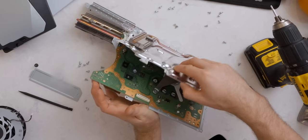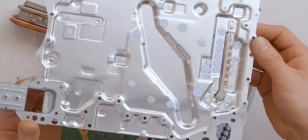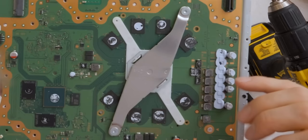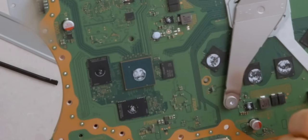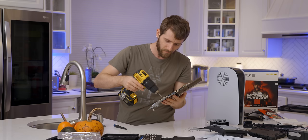That is not a lot of thermal compound — they've just got little dots on each of the DRAM packages and the NAND packages too. We're looking at 16 gigs of GDDR6 from Micron here. Here are our NAND packages for probably half of our one terabyte of storage. And here's our chipset as well as a DRAM cache, presumably for the SSD. Funny how as soon as they switch to the internals, all the screws use the same head and the same length.